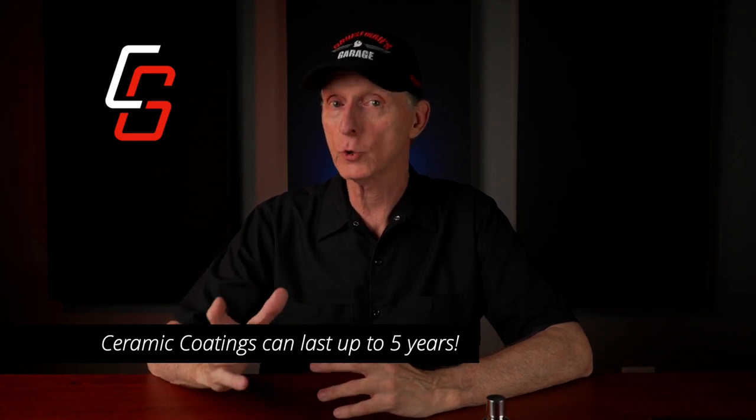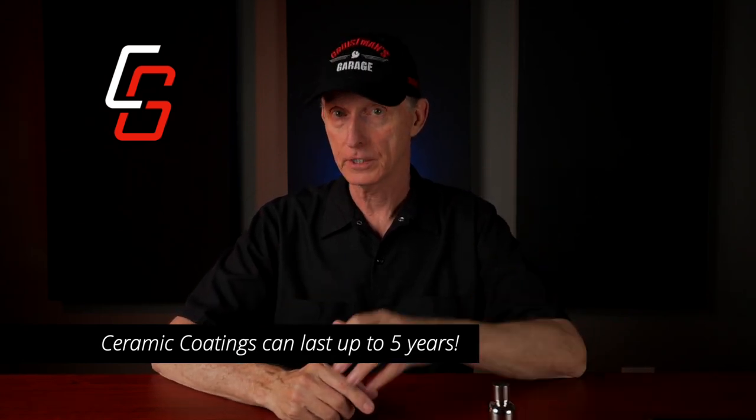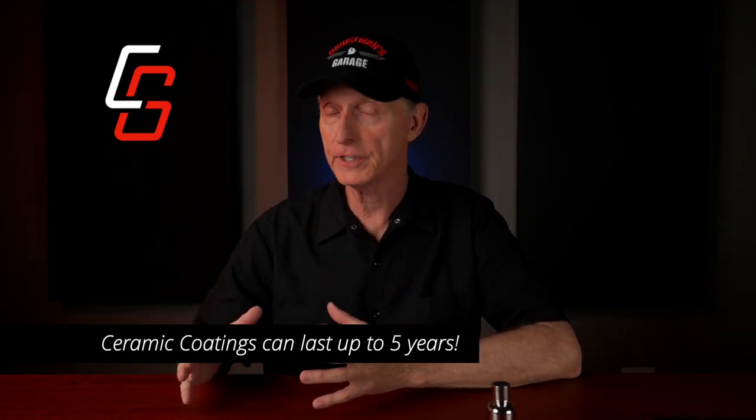Chemical resistance can range anywhere from 2 on the pH scale all the way up to 11, 12, or in some cases even 13. So you can use higher pH detergents when washing your vehicle without worrying about adverse effects to the ceramic coating. Perhaps the biggest advantage to these ceramic coatings is that they are super durable. Where carnauba waxes may only last one to three months and paint sealants five to six months on average, ceramic coatings are typically rated at one to two years or more. Armor Shield 9 is guaranteed to last two years and can last as much as five years. How long these coatings last will depend on the environment your vehicle lives in — do you keep your bike in a garage or covered? Are you taking measures to maintain your paint properly after applying the coating?